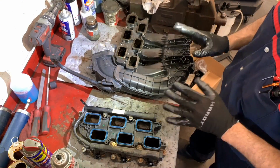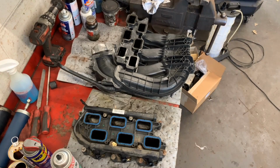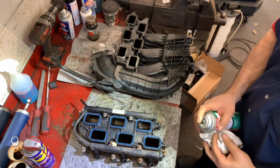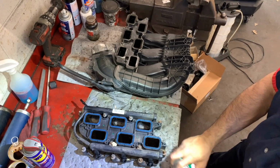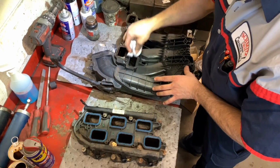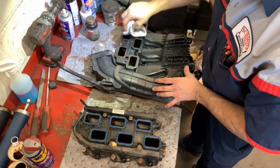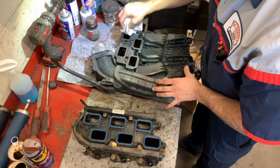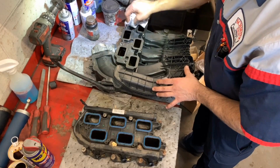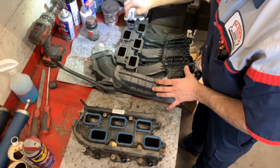These are all plastic, and I always clean it. What I do is just spray brake cleaner on a rag, at least for this flat surface. I don't apply it directly on the plastic. Because all that is important is to clean and dry the mating surface. This will be where the upper gaskets are. As you can see, that cleans it very well.